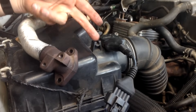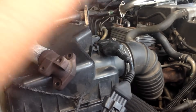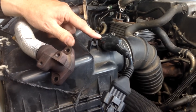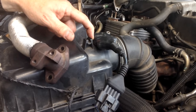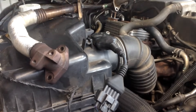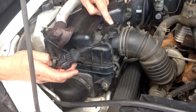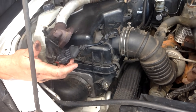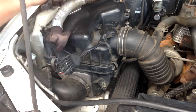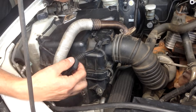One of the things that relies on this sensor is the amount of air going into the engine. The ECU uses that as a critical component to control fuel mixtures, flow, boost control, and everything else — it's a very critical sensor. But it also tells the ECU the inlet air temperature, and inlet air temperature is part of the ECU's mechanism for deciding whether to open and close and turn on the EGR. So this plug device changes the temperature signal from the airflow meter sensor before it reaches the engine ECU, causing the ECU to think the temperature is different and changing EGR operation accordingly.